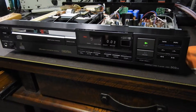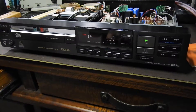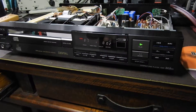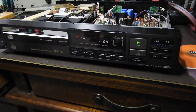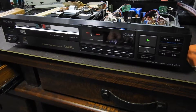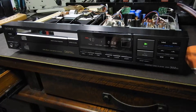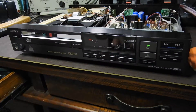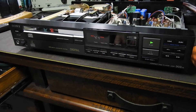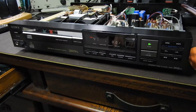Of course with this disc you can go to 1.1, 1.2, 1.3, 1.4, 1.5, 1.6, 1.7 millimeter — at 1.8 it has its first hiccup. Then we go to track thirty-nine or forty — the previous tracks were interruptions in the data layer, and this is painted material: not a dot but a triangle. So this is 1.1, 1.2, 1.3, 1.4, 1.5, 1.6 — it had some trouble finding it, but it did manage — and 1.7 millimeter.